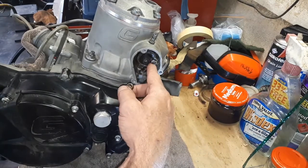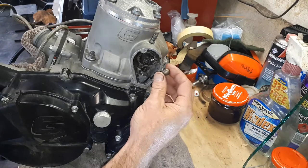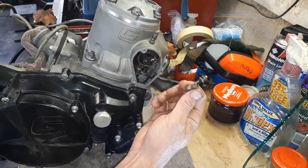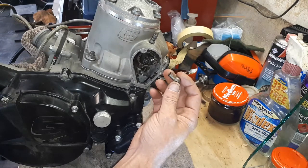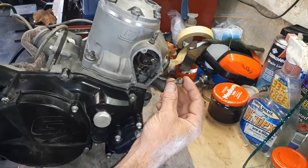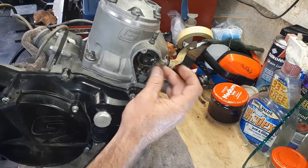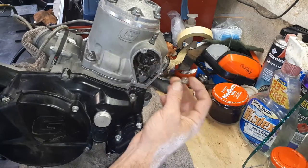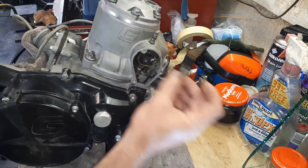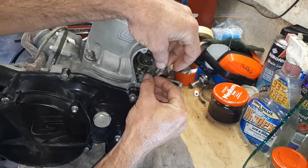So when you're doing this, there's a little lock nut on the end here. You screw the coupling on and then do the lock nut up tight. You want a good couple of threads in this. It is metal, thank goodness, but they are awfully small threads. There really isn't a lot of room there to play with. So when you're doing this, just try to get that power valve shut as far as you can get it, and have this hook on there quite easily. So we'll just screw that on.